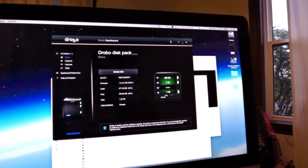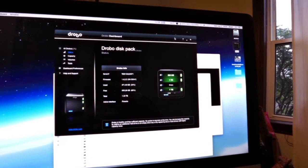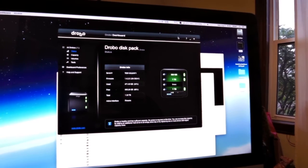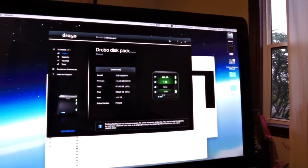This was a video on how to fix your USB 2.0 disconnecting issues with the generation 2 Drobo — the fix is simply to go FireWire if you've got the port. It worked for me and it is flawless throughout the day. Thanks for watching, we'll see you in the next video.